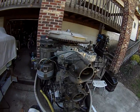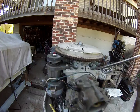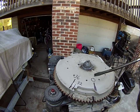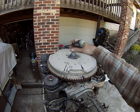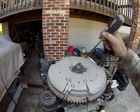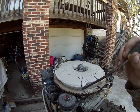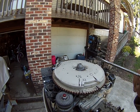This particular engine did not have a block pointer and the decal was missing from the flywheel. So I found top dead center, put a mark on the block and a mark on the flywheel, then counted the teeth, divided into 360, and got the number of teeth to make 32 degrees and 36 degrees. I marked those two particular lines also so I know where to time this engine.